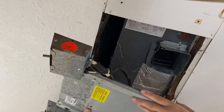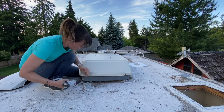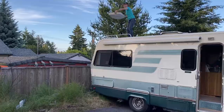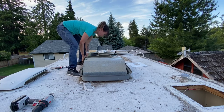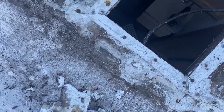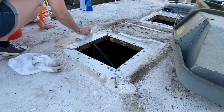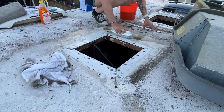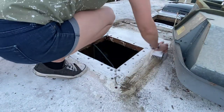I then went back up to the roof to start removing the old AC cover. With all the other appliances it was pretty easy — I simply threw them off the edge, which was actually kind of therapeutic. But the air conditioner was really heavy and big, so I couldn't just toss it off. I ended up having my daughter come up to help me lift it. Before moving forward, I cleaned up the area as much as possible and left it open to air out and dry for about a week. I then sealed the opening all around, inside and out, with some Eternabond tape.